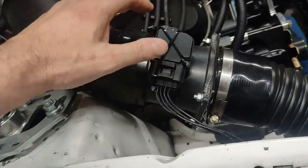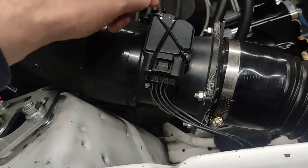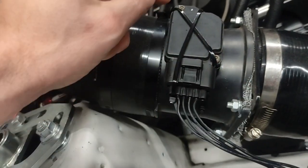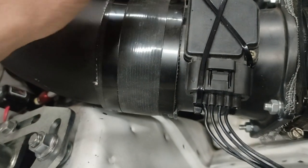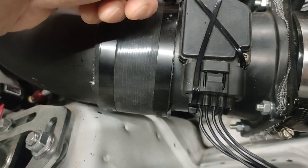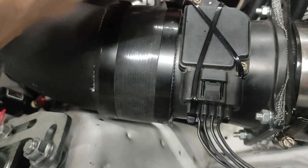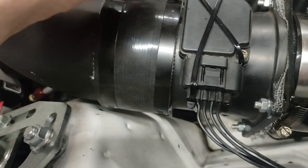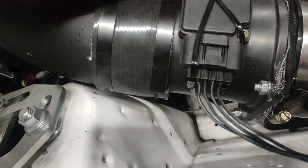I took the mass air out last night — I just undid the sensor from the top and cleaned it. What I realized was these are the security screws — this one came out no problem, but this one, they got the paint mark on it. I think I took this out before, but what it did was the thread insert came out with the screw. It didn't actually come loose, so maybe I had a vacuum leak right there. I put some crazy glue in there, reset it, and that's what these zip ties are on there for — to keep it all real tight while it was drying overnight.